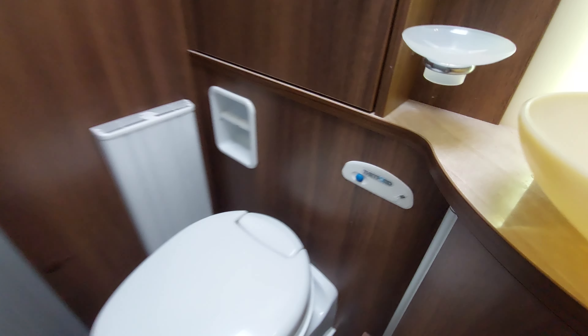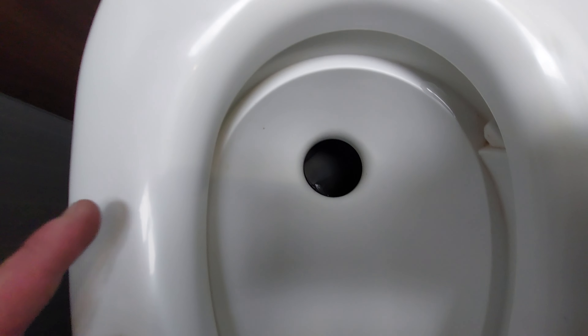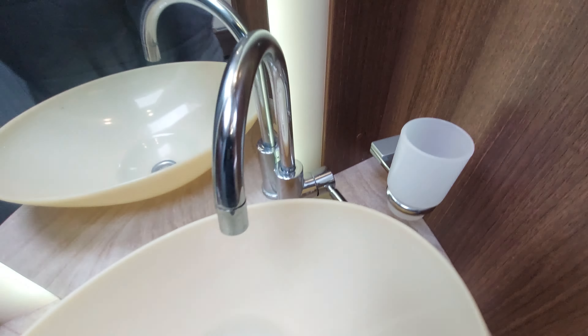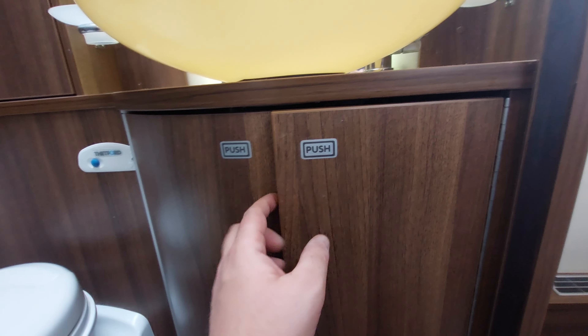There is a dividing door that divides the back from the front — it just magnetises up so you can do that easily. In the bathroom area we've got a flush button — once you turn your pump on you'll need to press that to flush the toilet. The toilet itself will spin around so you can use it, and at the back you've got a blade valve. You'll need the valve pushed towards the front of the vehicle for the blade to be closed; pull it towards the back and you'll see the blade is moving. You can only pull out the toilet cassette when the blade is closed. In here we've got your Alde heating fluid — it should run between minimum and maximum. We've got a soap holder, your light switches in the corner, and your toothbrush holder. When you're purging the taps, do it on the bathroom sink as well as the kitchen taps — it'll help get rid of the air.